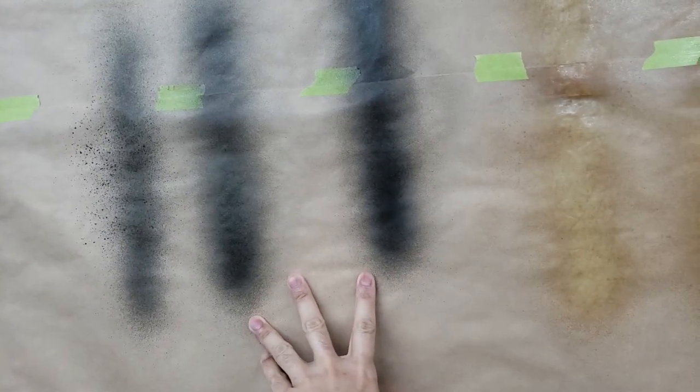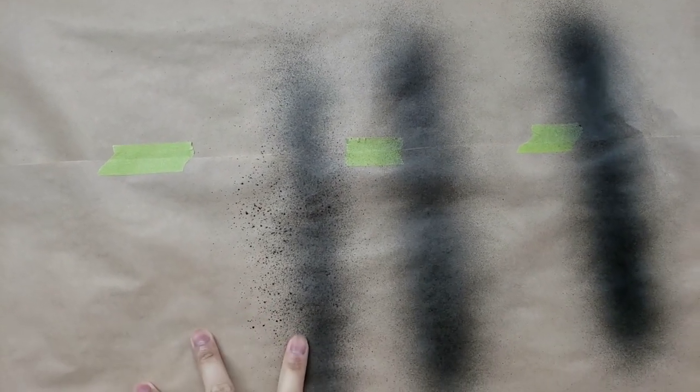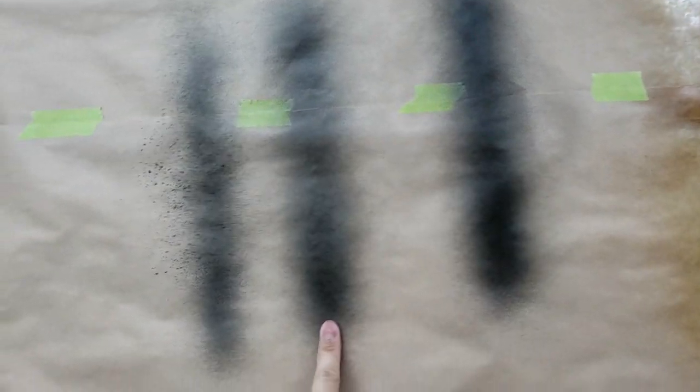Here's my wall. You notice how fine that spray is - that is what you want. I did three passes to set up my gun. The first pass, you notice all these big droplets - you don't want that. This is kind of what I sprayed my primer with. It ended up being super thick because I had it wide open and it sprayed horribly. So I spent days sanding my primer.